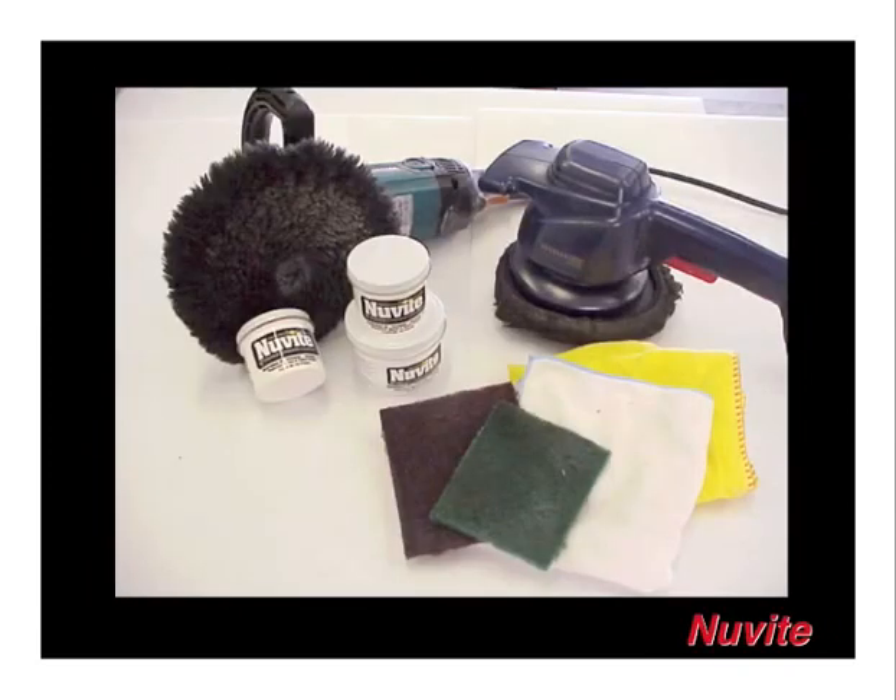In the early days of SONIX, we chose to polish almost all of our aircraft. We found a decent polish job did not require a huge amount of effort and was inexpensive and lightweight. A show-grade polish job, however, takes a lot of time and effort. We accomplished our decent polish jobs with less than $100 in polishing compound and a few hundred dollars invested in a nice auto polisher. In the upper left-hand side is a nice variable speed auto polisher with a wool buffer. In the upper right-hand side is a very inexpensive polisher — we do not recommend skimping here; buy a nice polisher. We really like a product called NuVite, which SONIX sells in a kit of three grades, kind of like grits of sandpaper: a rough finish, a medium finish, and a final finish, making three total passes to get your polish job. Other useful polishing tools are Scotch-Brite pads and nice cotton rags.